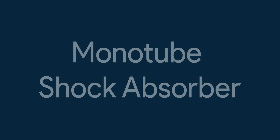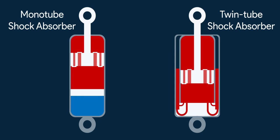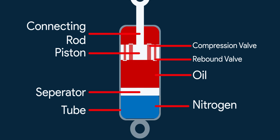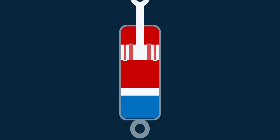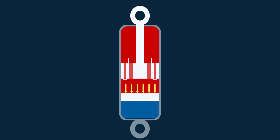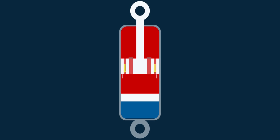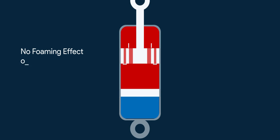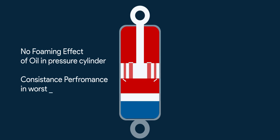Now let's talk about monotube shock absorbers. Monotube shock absorbers have a similar working principle to twin tube shock absorbers, but with better oil and gas separation and simpler assembly. There is just one tube in which there is a piston with compression and rebound valves. Then there is a separator in the tube, one side of which is filled with oil and the other with pressurized nitrogen gas. The separator prevents mixing of both. There is no base valve in a monotube shock absorber. At compression, the piston travels down and some oil passes through the compression valve. All of the oil cannot be accommodated behind the piston as the rod consumes some space, so some oil pushes on the separator, compressing the gas further and making space for itself. At rebound, the piston travels back and the rebound valves allow the flow of oil with resistance. Simultaneously, the gas also pushes back on the oil to release its pressure, ensuring there is no foaming effect and consistent performance even on the worst and most frequent bumps.